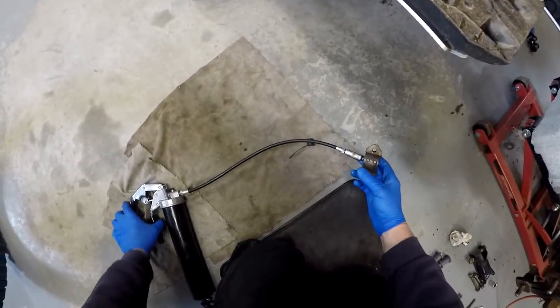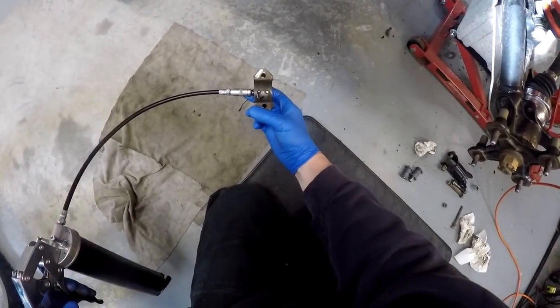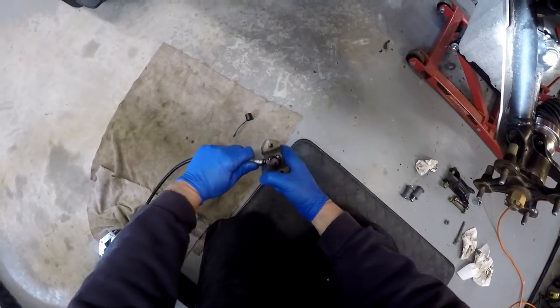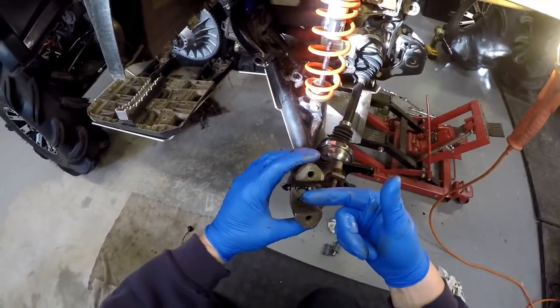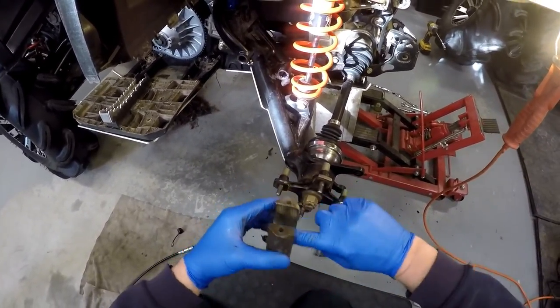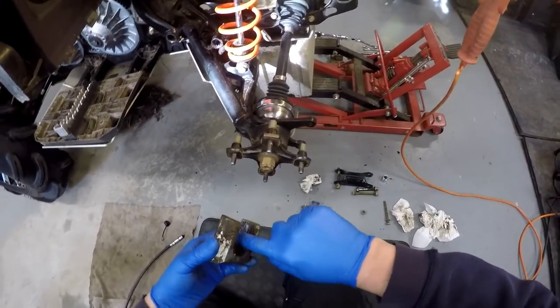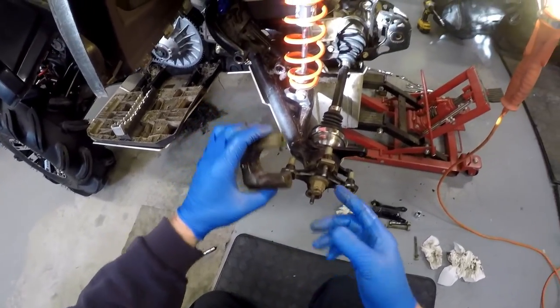A little demonstration here — see what happens. You see that come out? You're forcing that into a sleeve and a bar that is tight in there. So you're not going to get any grease in there, so you better put the grease in now. Probably the best way to deal with these is to take them apart and grease them up every now and then.